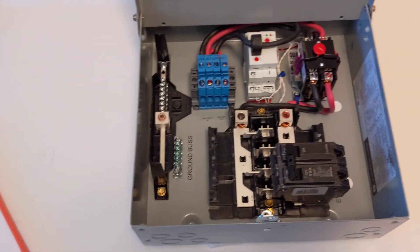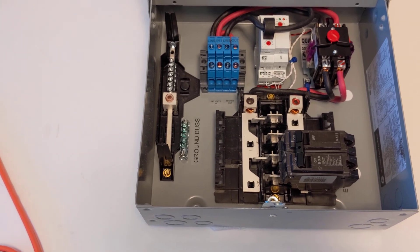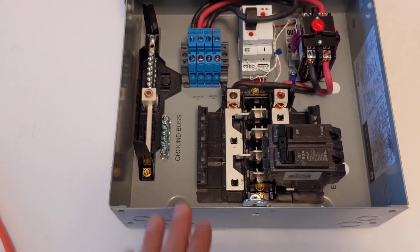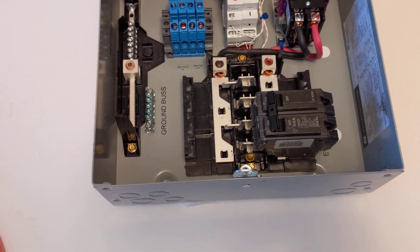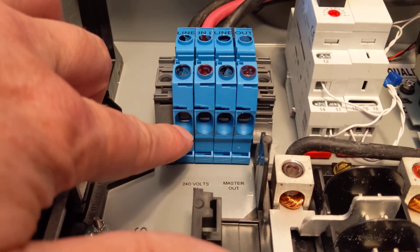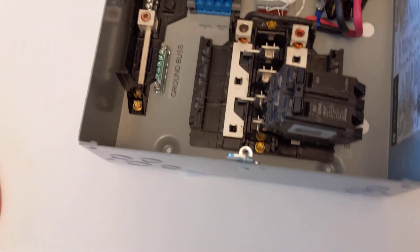This is universal — you don't have to use this for electric cars. You can use it with anything you want to power: a welder, a kiln, high-power lighting. The circuit can be a dryer circuit, a range circuit, or the hot water circuit in the garage. Imagination is up to you. It is designed to accept very large gauge wire, up to four gauge, and the breaker has very large lugs as well. Make sure you're using the appropriate size wire — this will handle very large loads.